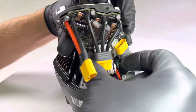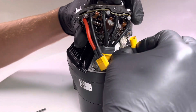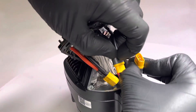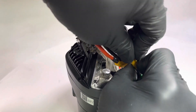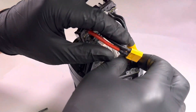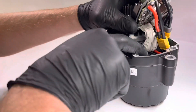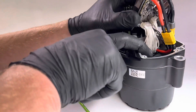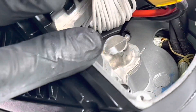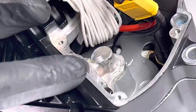The next connection is the main phase wire — this will only let you plug it in one direction; rotate it clockwise and plug it in. Finally, plug in the main discharge wire — the XT60 goes on the bottom, underneath all of the other connectors. Now take your time and rearrange all your connectors so that they sit in the main cavity. You don't want them pinched between the area under the encoder.